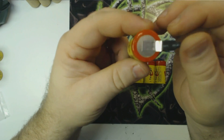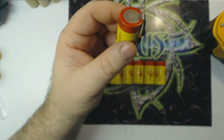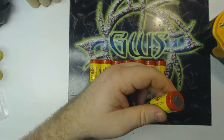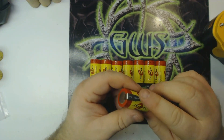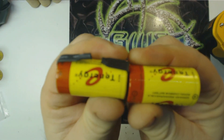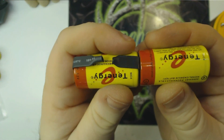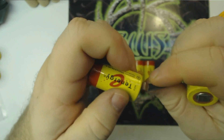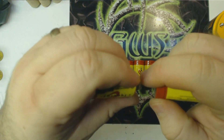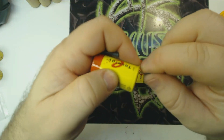The tabs are actually nice if you're making your own battery packs like a stick pack. If you're going to be making stick packs that go end-to-end like this, they're kind of nice because instead of trying to solder the battery directly to the battery, you can bend the tabs, pre-tin both tabs, solder the batteries together, and then just fold them down on top of each other as flat as you can get them.